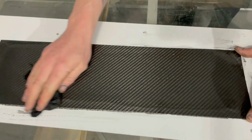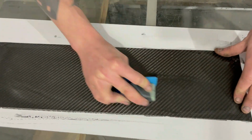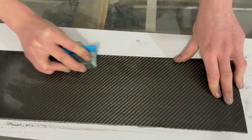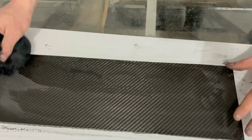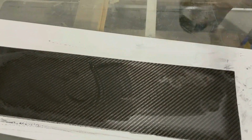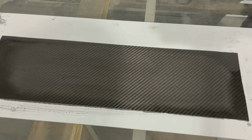Merv is back onto 240 grit paper, taking his time to make sure every last scratch is out. This has taken him about 45 minutes so far, which has got to be worth a subscribe. But we think we finally have the scratches out. So now for 400 grit.